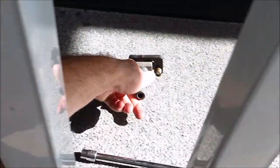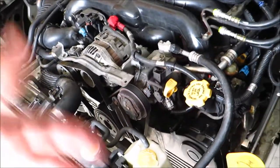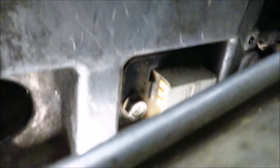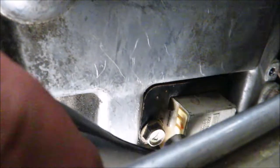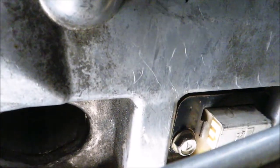If you're doing diagnostics tests, you want to make sure you know which coil is which, so I just lay them out on the porch in the way the engine's laid out. Cylinder 4 — same deal. Come in here with the ratchet, break it loose, and then thread it out the rest of the way by hand.